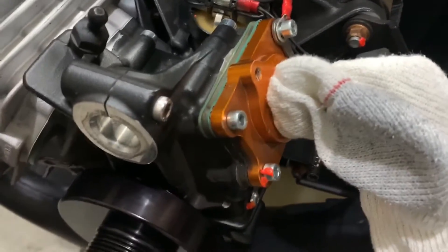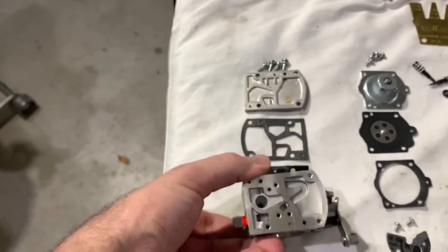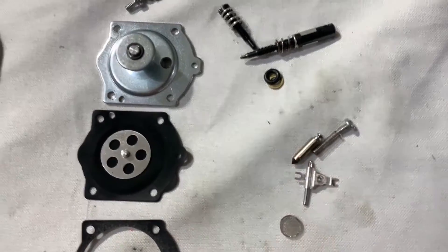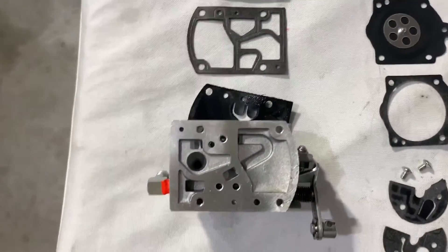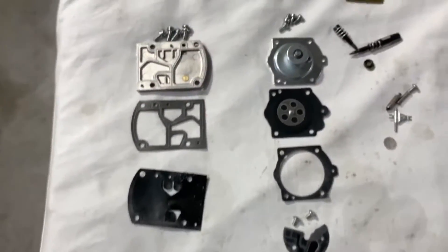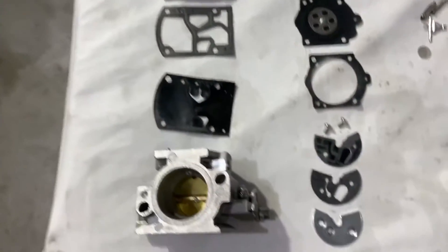The saga continues — the carb is off and I've taken it apart, cleaned it all out. I even took the screen out because that goes all the way through to the inlet pin, and it came out really easy using a pick. I have a method for putting it back in easy enough. When you take it apart, just line everything up as it comes off nice and pretty, that way it goes back exactly the same. When I open the new kit I'll just lay out the new pieces.